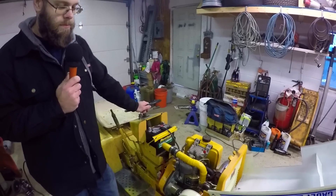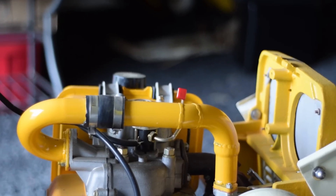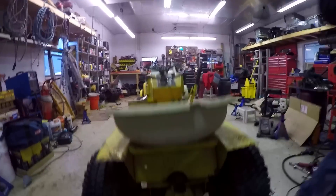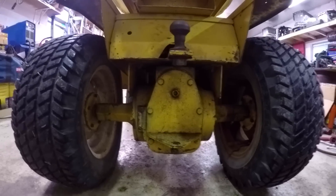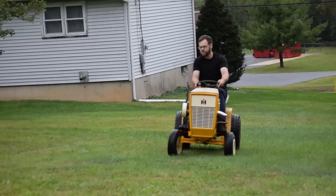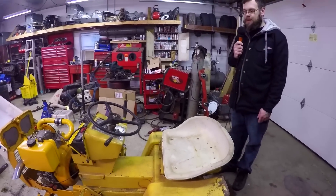There was a Sloppy Mechanics video — this was on the dyno. It made 3-point-something, maybe 3.6 horsepower, which I thought was going to do better than that, but there's a lot of loss in this setup. This has a hydrostatic transmission. The rear ends on Cub Cadets are practically car rear ends — they actually have a ring and pinion. A lot of tractors have a belt drive setup, but these are shaft drive directly off the engine. No belt, no slippage. It's a very substantial differential with large axle tubes. There are modifications for tractor pulling where you put Dodge Dart ring and pinions and carriers in them. The rears are pretty stout, so there's a lot of gear reduction where you're losing power. Plus the transmission in this slips — it's not in really good condition, which I found out once I got it running.